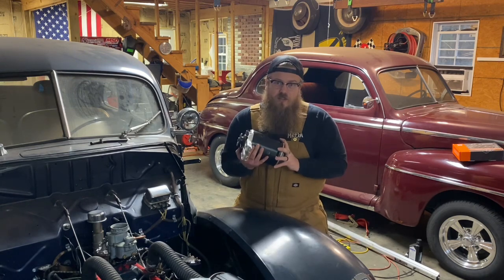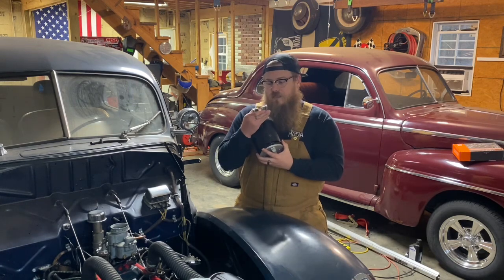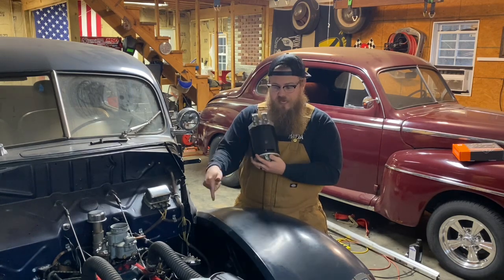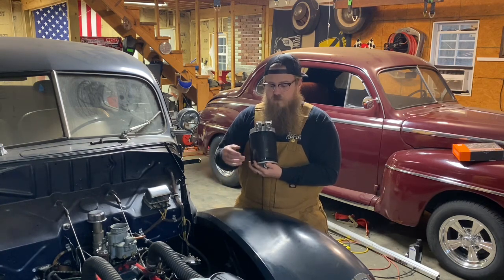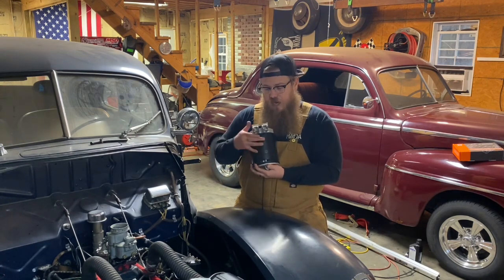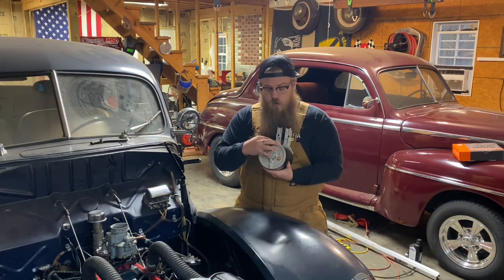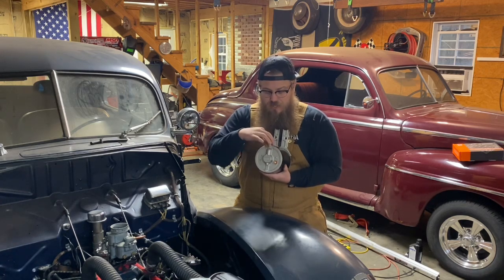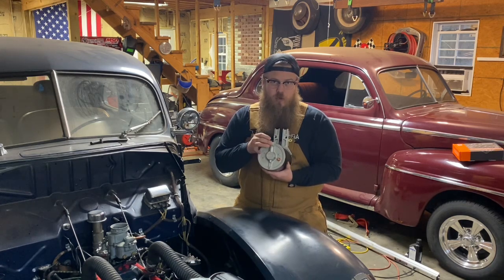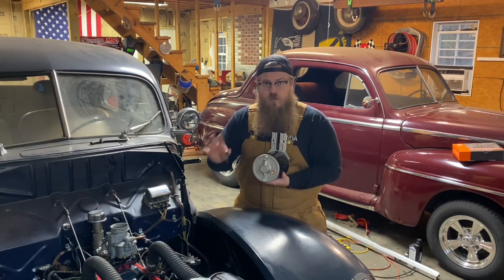There's 2 things that I like to do. One, I'm going to grind the intake surface where this bracket sits, so this will be nice and grounded to the intake. Your motor should be completely grounded to the battery itself, so technically the intake surface should ground it. Also, another thing that you could do is take one of these bolts out, or just partially out, and put one of those finger eyelets in here and actually ground the housing from the back of this bolt here. Make sure you keep that in mind when installing it on your car, otherwise it will not charge at all.